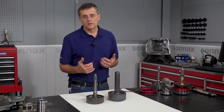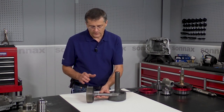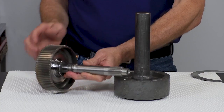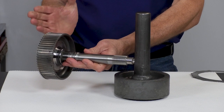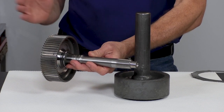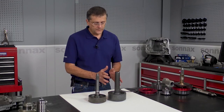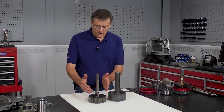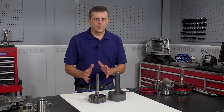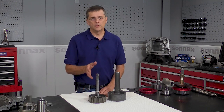To me, the real benefit is you end up with a more precise assembly once you're done. What we've seen with a lot of aftermarket two-piece shaft and hub assemblies is that when the shaft is rotating, the hub will actually be wobbling a little bit, and that will contribute to wear further down inside the transmission. With a one-piece forging, you're able to machine the hub and the shaft as an assembly and keep everything in alignment so the hub portion is perpendicular to the shaft and it's all running true and precise.